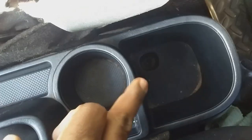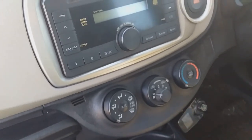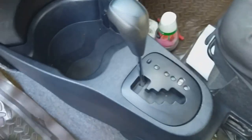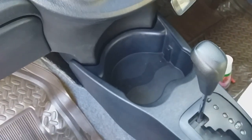You can easily remove the center panel after removing that screw and pulling this up. This is how you remove your center panel from a Toyota Vitz, and I would assume any Toyota vehicle having this type of center panel. Thank you for watching — please subscribe and have yourself a nice time.